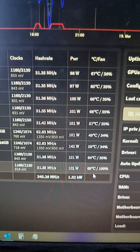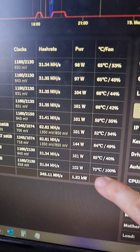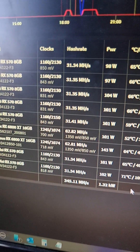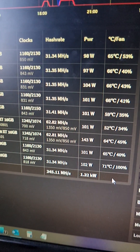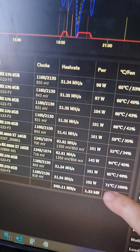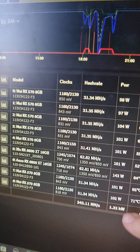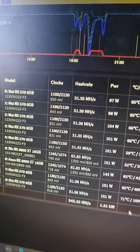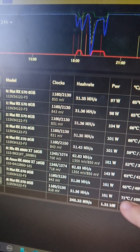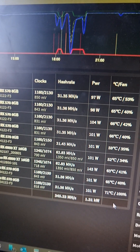So there is a different problem with this card. The temperature stabilized a bit - around 70 to 71 degrees. So the thermal paste did help something; it has better thermal conductivity. It dropped from 77 to 70-71, which is better but not good enough. I would like to have 40% fan and 66 degrees on the GPU instead of 71 degrees and 100% fan, which makes a lot of noise.